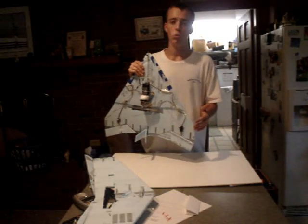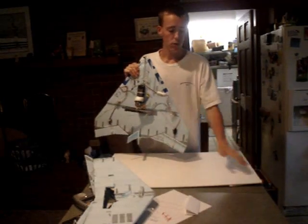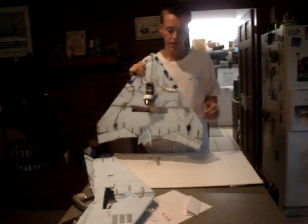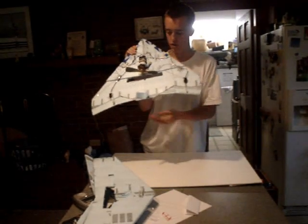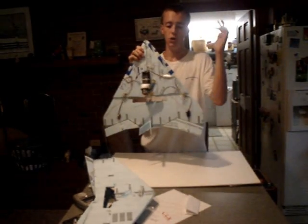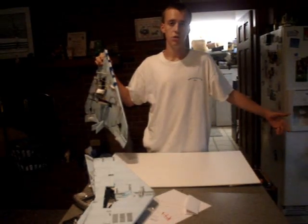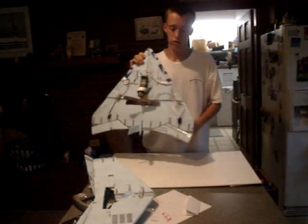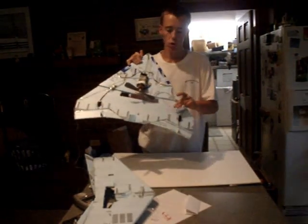Take a big ruler or whatever. This is 19 inches. What I had to do is basically take a slab and put it on the floor going up 19 inches, and then take this — it was like 6 or 5 inches — and then do that from the trailing edge, and then connect those with a big 37-inch stainless steel ruler, and I got this right here. That was my mean aerodynamic chord.